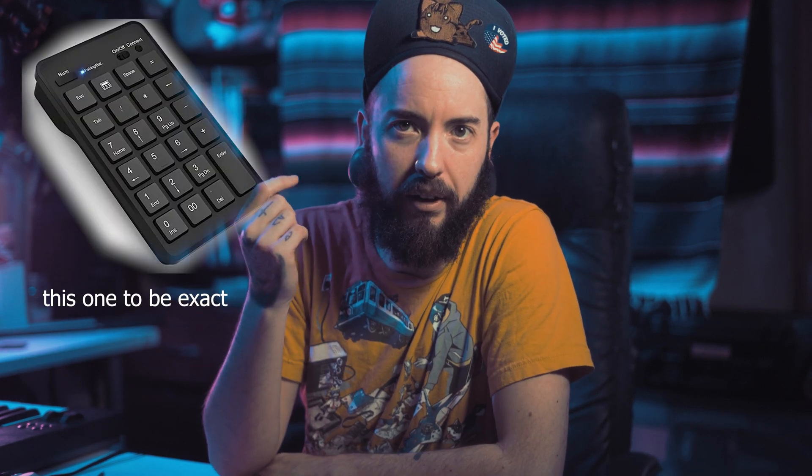Author's note: the first time I did this, I purchased a Bluetooth number pad that had the double-zero button. You might also see some with a triple-zero when looking through keyboard options. I would suggest against these, as those keys essentially just send the same zero key signal except multiple times. There is a workaround for this, but save yourself the hassle if you can. Trust me.